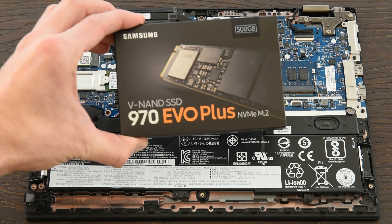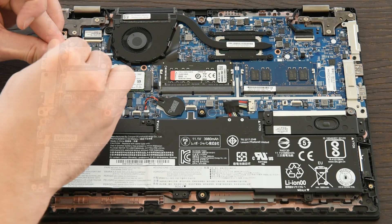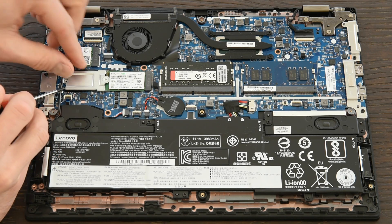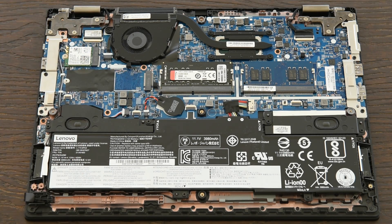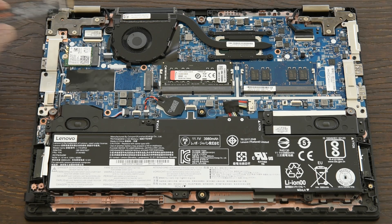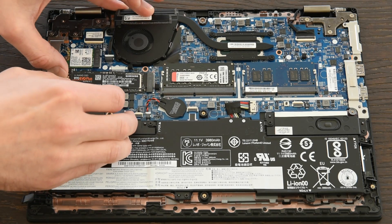Here's our 500GB Samsung 970 EVO+. We'll take this screw out — mine was torqued pretty hard, so I'd use a different type of screwdriver to get it loose. It might be easiest to pry the adapter side up just slightly so you can slide it out. Our new SSD is the full 2280 size and we'll use the existing screw hole. Insert it at an angle, push it all the way in, and it should seat well just like that.